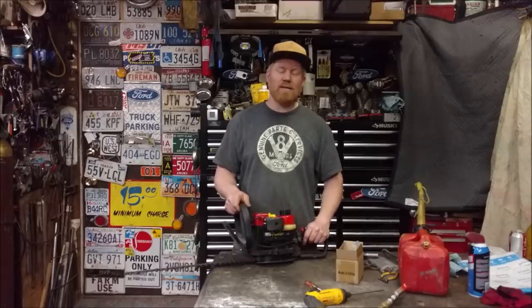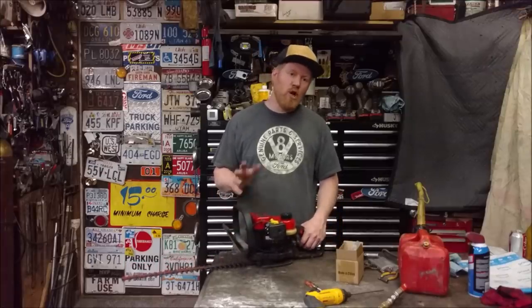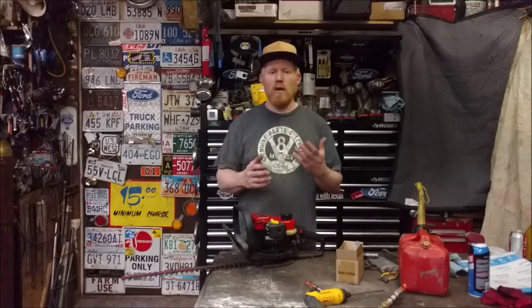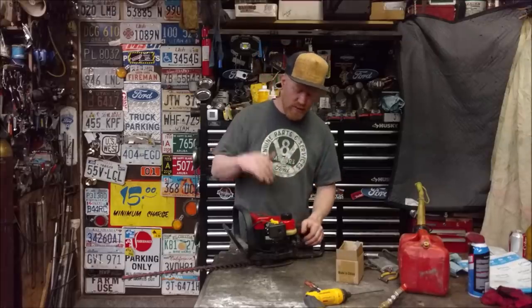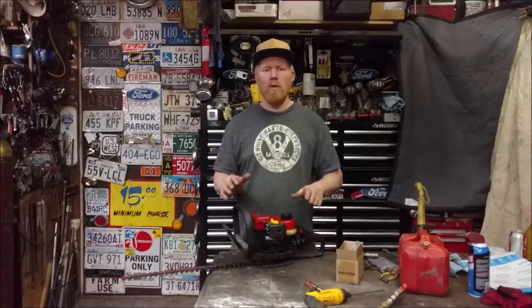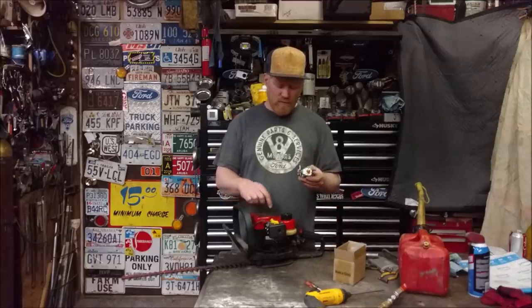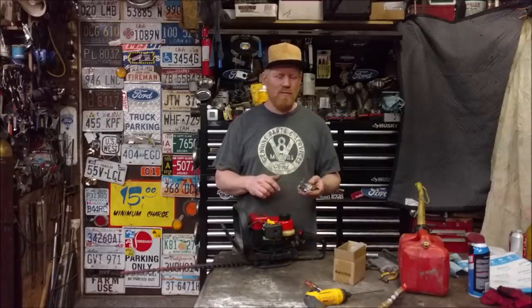Is it worth it? It does get the engine running for the most part. Most of the ones I've used on snowblowers, weed eaters, and little mini tillers, I can get them to run, but they never run perfectly. Some of them are too lean, most of them are too lean, and I have to drill out jets and do a fair amount of carburetor work to them. It's never just a cut-and-dry thing. If your carburetor is completely corroded, rotted, and junk with no way to rebuild it — yes, get one of these. They come in kits with new hoses and a filter.